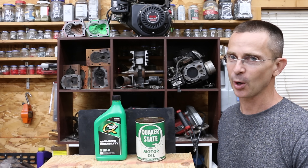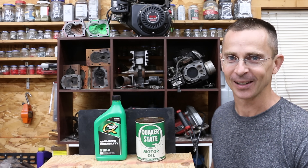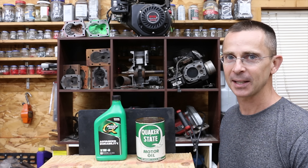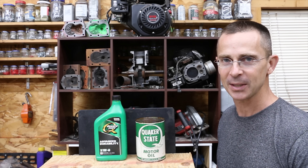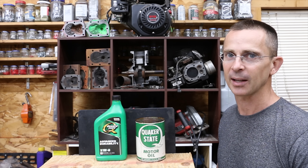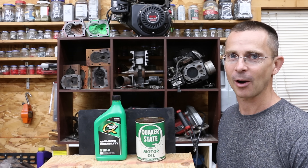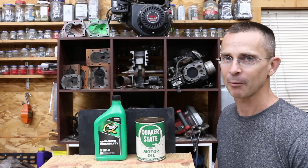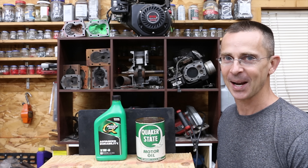One thing for sure — they sure don't make motor oil like they used to, and that's probably a good thing, or our cars probably wouldn't last that long. I had a lot of fun testing this vintage oil, and I just want to say thanks to the person that sent it to me. It was really interesting to see the difference between the old and the new. The old oil just did not flow very well on the cold oil flow test, and it did not do well on the evaporative loss test. Even in the small engine run, we could see a lot of vaporization coming out of the positive crankcase ventilation tube. All videos on this channel come from viewer ideas, so if you have one, please leave a comment — I read and reply to as many as possible. Thanks so much for watching.